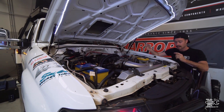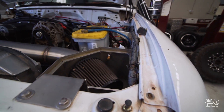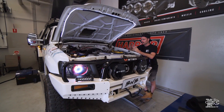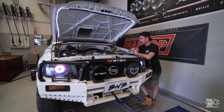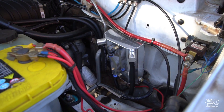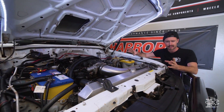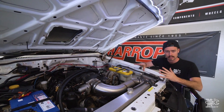I'm going to whack the street tyres back on the back there and get this thing spun up. Another thing I may experiment with is the airbox, because I've got quite a small airbox. I'm going to be doing a second snorkel — so I've got twin snorkels coming — which means there's going to be a lot more airflow coming in. To simulate that, I want to take the cover off the airbox so it can breathe a bit better, which is what's going to happen in the future when I get that second one hooked up. I've also added a catch can as well — that's something I did last week. A couple of the vents coming out of the crankcase were recirculating a lot of oil blow-by back into the intake, so I've got the catch can on there now to capture that oil. Similar to what gets done in a lot of diesels.